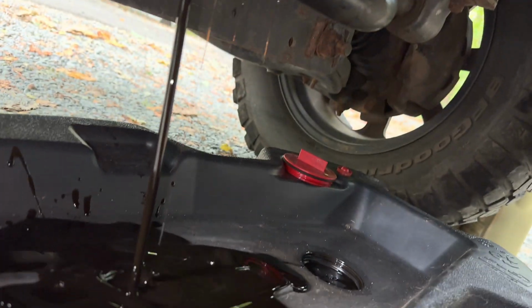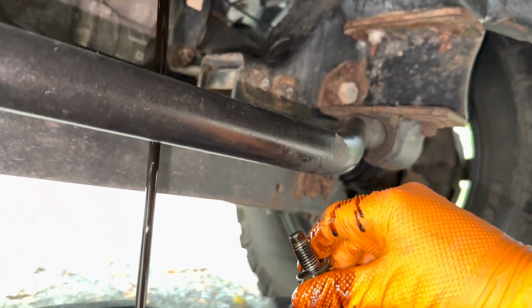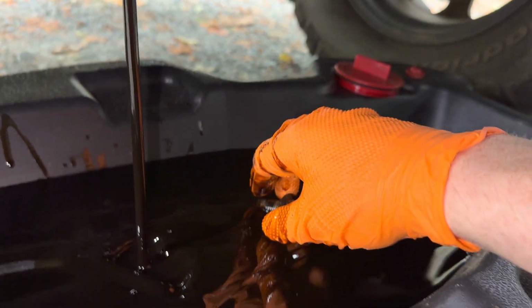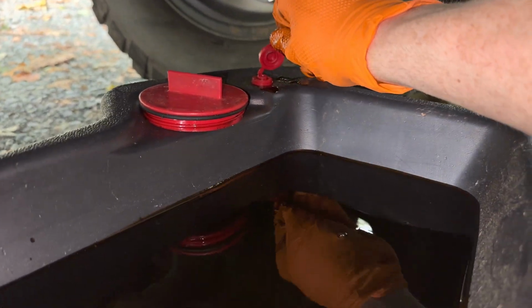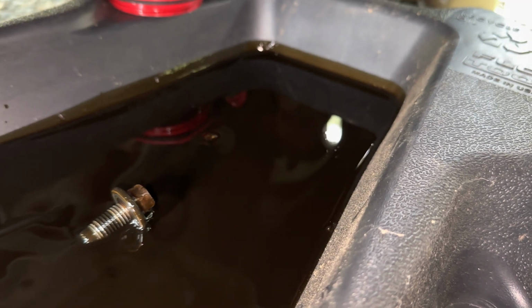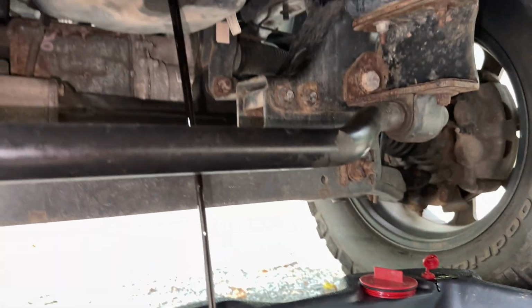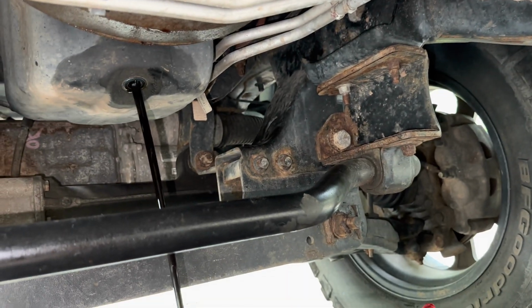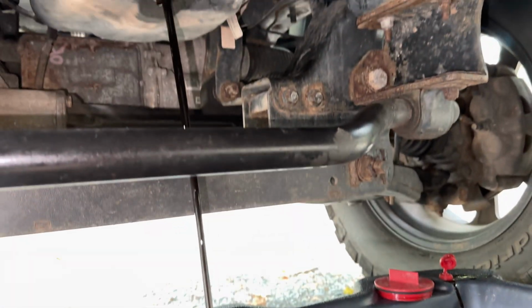All right, that is what we want. Here is the plug. There's a lock washer supposedly on here. I guess it's still on there, or it might be on the plug. I will let you know. Oh, it's bubbling. Bubbling crude. Oh, wait. Unplug the little air gap so it could suck in. There we go. All right. So while this is draining, what I'm gonna do is replace the oil filter now, so it gives this plenty of time to drain out. And the oil does not smell gasoline-y or anything like that, so that is awesome.